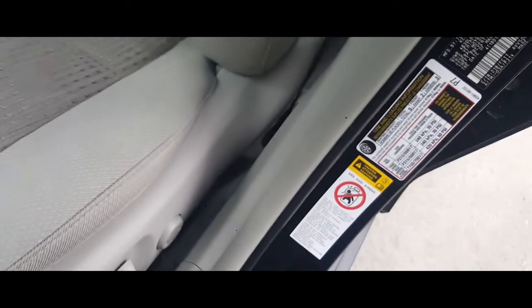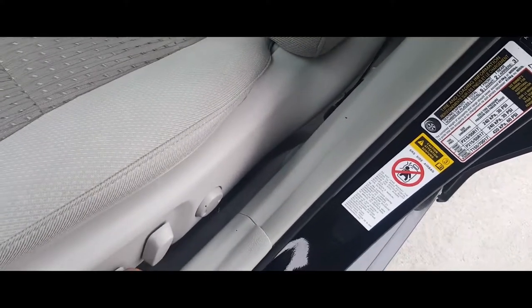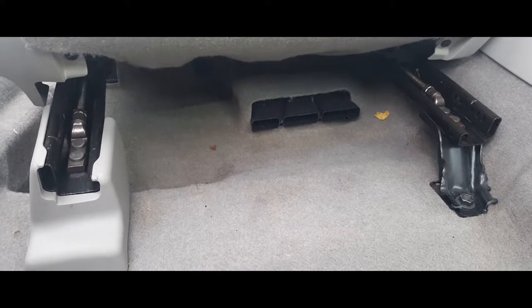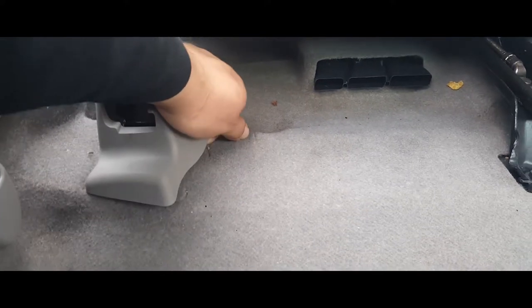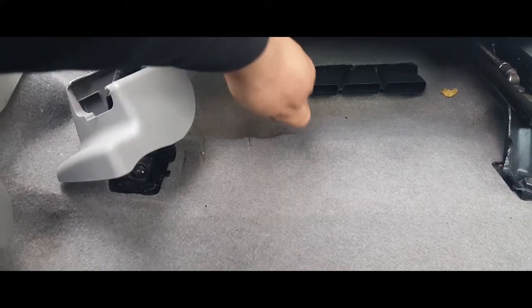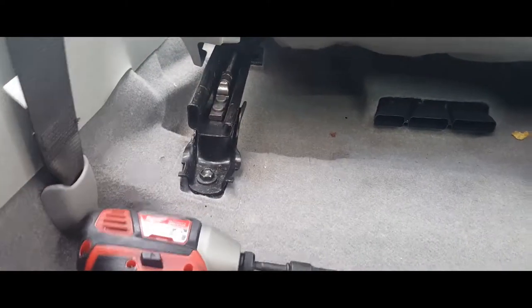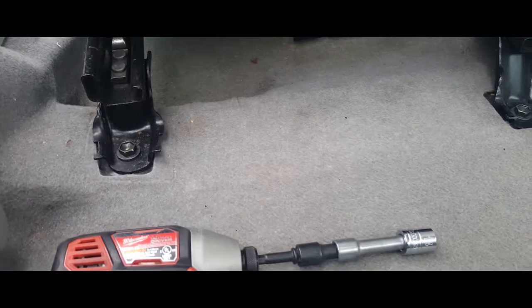Set the screws to the side. There's going to be electrical wire down there, but we'll worry about that when we get to that part. Now we're going to move our seat forward. With our seat forward, that gives us access to these back bolts. To remove this casing, just pry it up and back and it comes right out. Let's go ahead and remove these back ones.